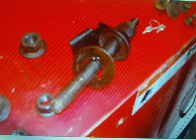That's from the top. Here's where the bracket for your transmission cooler bolted on, with 2 nuts on each side, 1 nut here, 1 on the other. Then this here went on top of your steering rack bushing, and that's the little blocker stopper. Then the bolt goes through. Then at the bottom of your frame there's this washer, and this big nut goes on the bottom. But if you just watch how it comes apart, you'll see how you need to line yours up and what was on the bottom, and it's simple. Don't let it scare you.